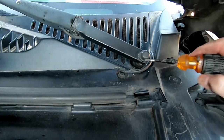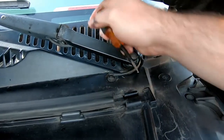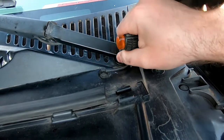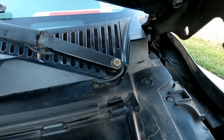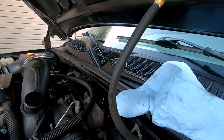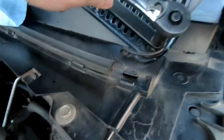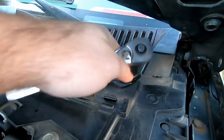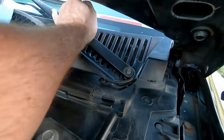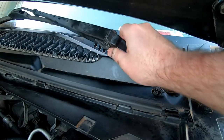To get started on this swap, you basically want to pop off this little rubber or plastic cap. That's going to be covering a 13-millimeter nut. We'll spray a little bit of PB Blaster on here and hopefully get that to loosen up, because the passenger side wiper wasn't moving when I tried it earlier. There's your 13-millimeter socket — that was barely even tight.